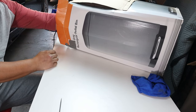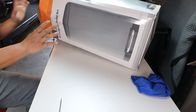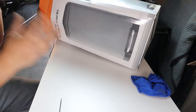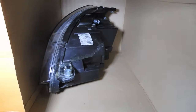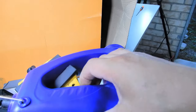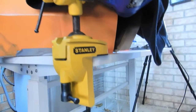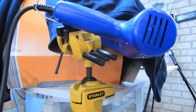Point the heat gun into the box away from the headlight, then cover most of the opening with a towel or cloth so the heat stays inside. Whether you use a box or a cupboard, you just need to make sure you've boxed in the heat so it heats up the headlight evenly. The heat gun is pointing into that corner and will move around to heat the whole headlight. The headlight is sitting on top of the ballast. Close it with the best seal possible and turn the heat gun on low.